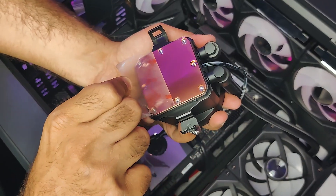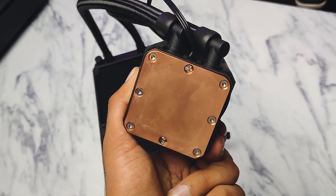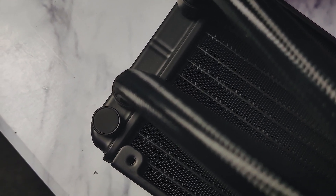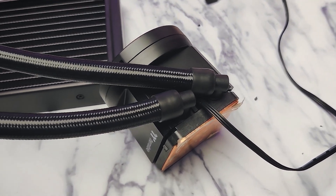You can rotate the display in any direction according to your choice and it will be good to go. Talking about the base plate of the pump, it is made up of copper and backed by a 3200 RPM pump. It is a pump and block assembly like other standard AIOs, attached to a pre-filled radiator. The copper plate is wide enough to cover all supported heat spreaders entirely, which is really important for thermal performance. Thermaltake has also provided low-evaporation tubes into this AIO, which effectively decreases the loss of coolant over time — meaning no need to refill. The connecting pipes are 400mm long, connecting the radiator with the pump through fittings, and you can also adjust the pipes through these fittings easily.